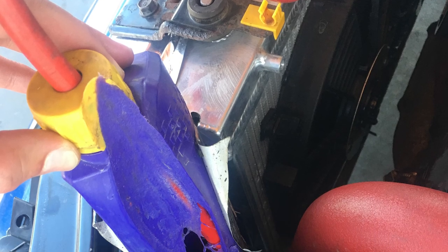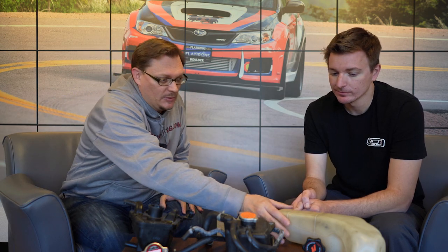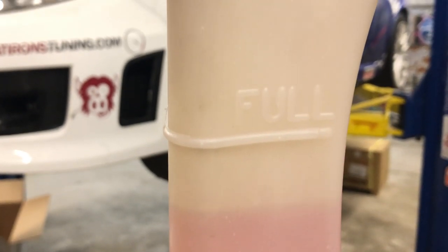So let's move on to the expansion tank — I'm actually going to say that beyond the radiator cap, that is the most important piece of the cooling system, and it is very often disregarded and not thought much of. I've even seen people use Mountain Dew bottles or Gatorade bottles as their overflow tank. It really is critically important. This sits next to your radiator and there's a hose that goes down mostly to the bottom, and you've got these two marks — the low and the high, or the cold and the hot — and it gives the coolant in the cooling system a place to go when it warms up and reaches normal operating temperature.